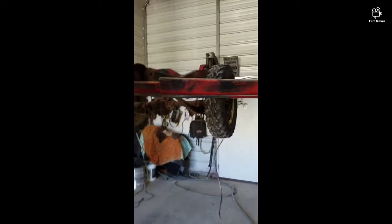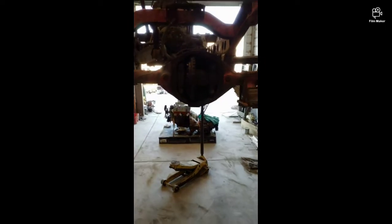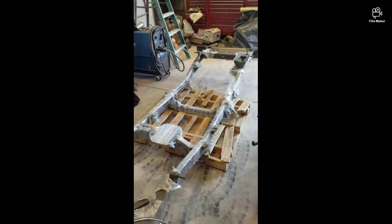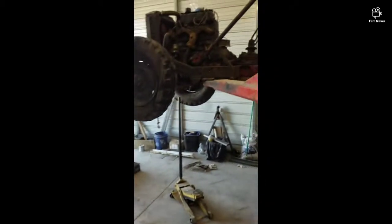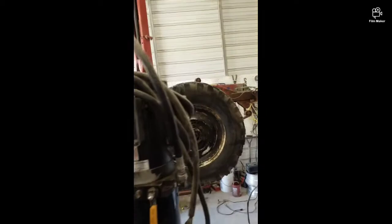The rear end, as noted in the other video from last week, has a big hole in it. Now I had done something similar to this in one of my Dana 35's from my Wrangler - I welded up the bottom where I tossed a pin through, and I ran it for another two years like that, surprisingly enough, and it worked. It held fluid. I was tempted to try to find another one, and I'll continue to look, but I do plan on welding this one up.